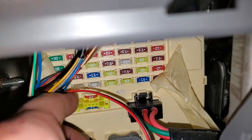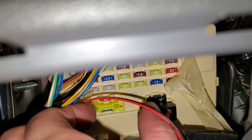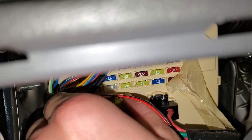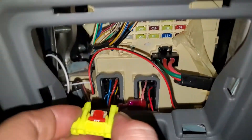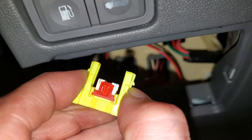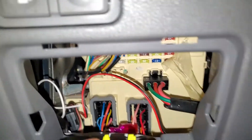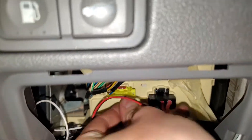There's another fuse called the room fuse and it's actually right in here. There's a special way you remove it — you just pinch it on either side. First you pull it out and it's going to come out and stop at a point, then you pinch on either side and continue to pull out. What you're pinching are these little pieces right there on the side. The top 10 amp fuse is the room fuse for you to check, and it just pushes back in like so.